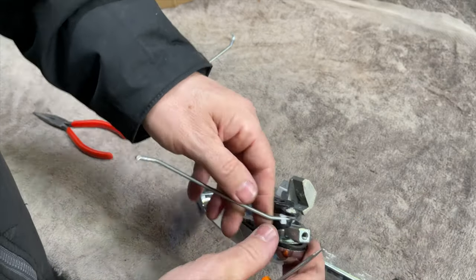I can turn that back down, noting which way round we are. We can now try and pop out this barrel, which is going to be stiff. Turn the key, give it so you can get hold of it, and it should come away with a little tug like that, bringing out the little seal there, the dust seal. So again, keeping it all the same way, which is that way up, that's the way that's going to go back in again. So we'll draw that out and we'll pop that back in there,